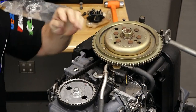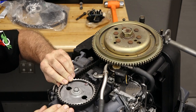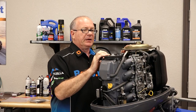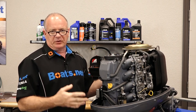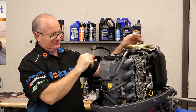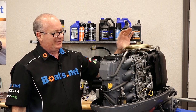Just doing a quick visual inspection — I'm always curious to see if these have been replaced before. This one looks like it might have been done, but it's about 16 years old now. That is way past time to go ahead and replace it, because like any other rubber piece, when they get age on them they start to deteriorate and crack. What'll typically happen is it'll actually round off these teeth or just strip them off. Your engine's still turning, the camshaft stops, and then you go in and it bends the valves. Really not a good outcome.